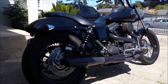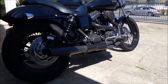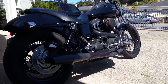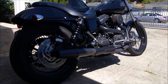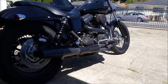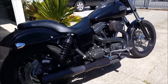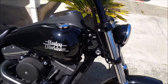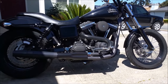I didn't scrape before on the stock suspension, but with a passenger I would scrape the bottom a little going over bumps or at certain angles turning with weight in the back. Raising the rear end helped with that. Handling-wise it dives in easier now because you're a bit taller, absorbs bumps nicer, and when you stop the front doesn't dive anymore. For the front end, some people just do emulators, but if I'm going to mess with the front I'll just go all out and change the forks.